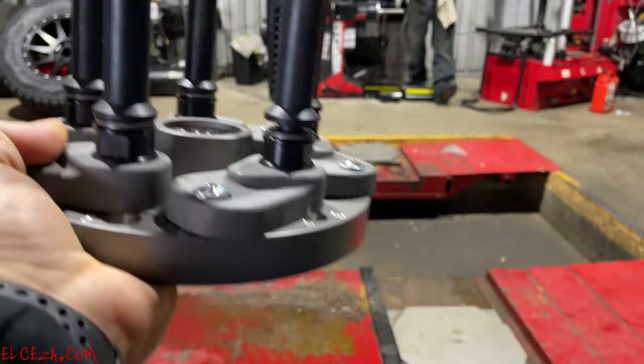Okay, you'll hear it come down, and then you'll hear it back off. If you're watching, you'll see it back off. What it's doing when it comes down and puts the weight on it is spinning one direction. We're looking for the high spot in the egg of the rim. When we back off, we're looking for the high spot in the egg of the tire. So now I know where they are. That's how I can tell you where to put the two marks on the tire. So a quarter of an ounce, TDC right here, is what I need, even though it knows there's a problem with this rim.